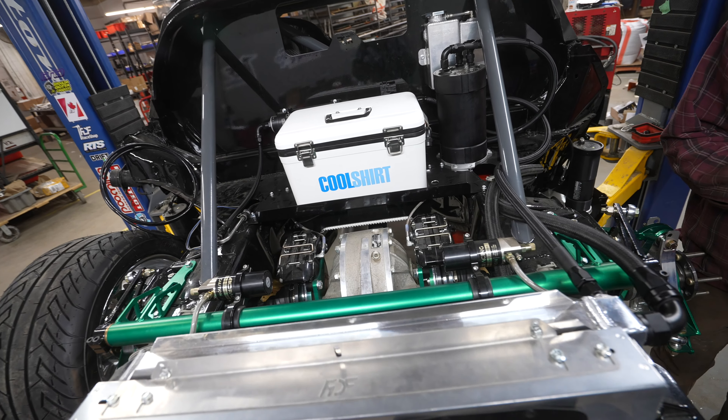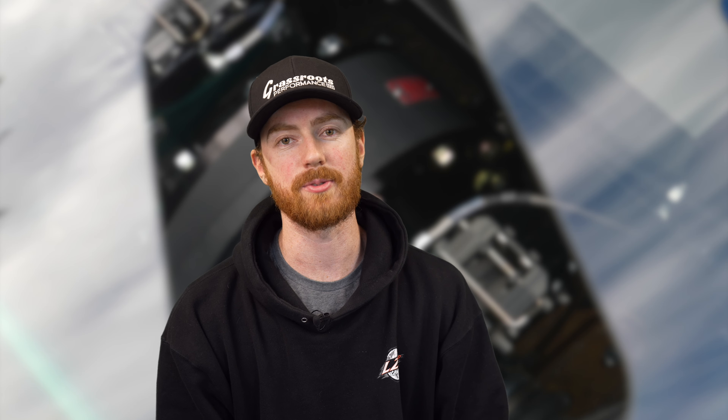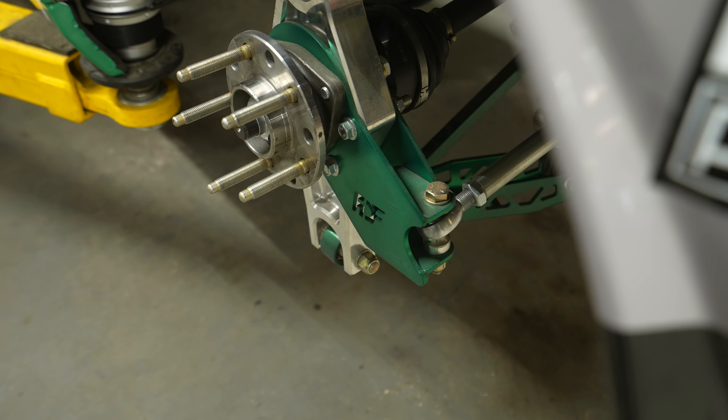The other thing is that brake force dissipation is going to be the exact same as acceleration but in reverse. All of the brake forces are going to go through the diff and through the chassis itself, using the subframe and everywhere that it's bolted to, to actually slow the car down. The wheels connected to the axle, so the loads go to the axle — that is the exact same path but in reverse as accelerating.